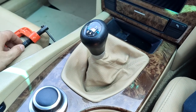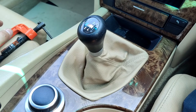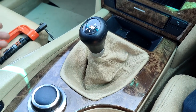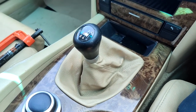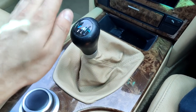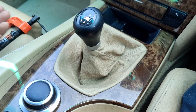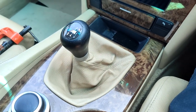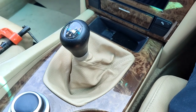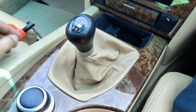How can you know that your brake pads or brake discs are worn? If you remove your wheel and see that the brake disc is black, it means it's worn and it's not going to brake as it should. Also when braking, if the brake pedal feels like it's bumping, it might mean the brake disc is no longer straight or the brake pads are worn. In this video you will see how brand new brake discs and brake pads look, so with a visual inspection you'll know roughly how much life you have left.